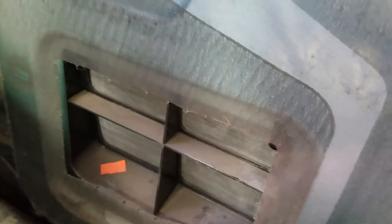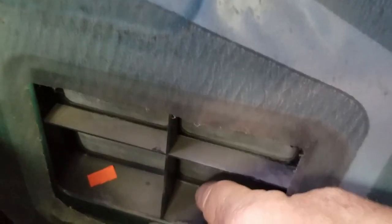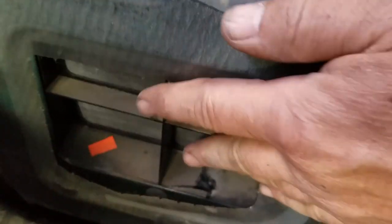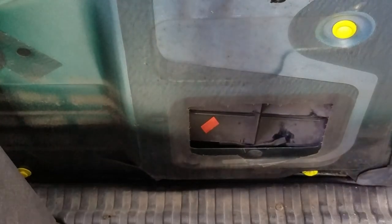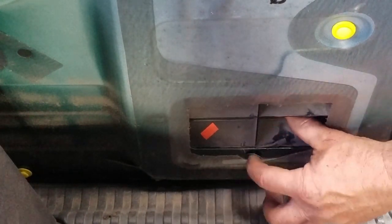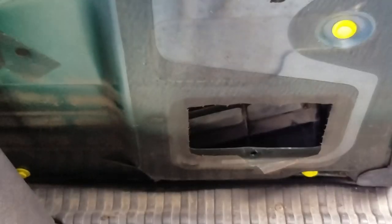Now what we have is the door vent — ventilation for equalizing air pressure. You need to get at this push pin right here so you can take this whole unit and push it this way. Get this push pin out and then your latch is down underneath. I'll bop this with a hammer and then pull this push pin out. You can screw it down in here and wiggle it. Take your needle nose, sneak in behind that, and gently pull that out. There's your push pin — put that in a safe place.